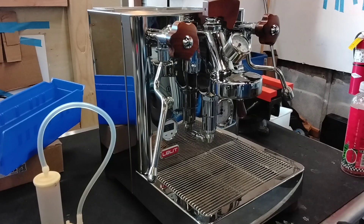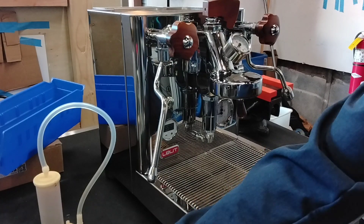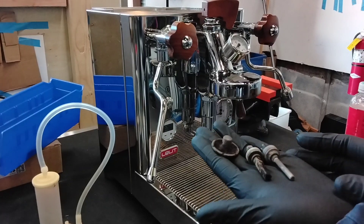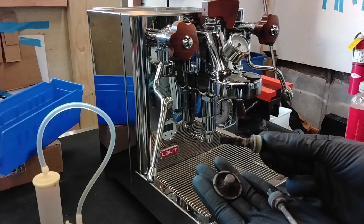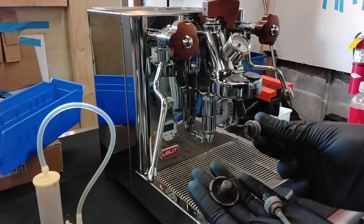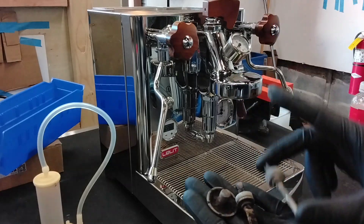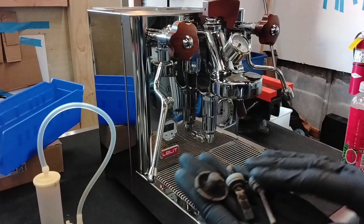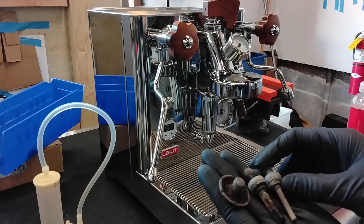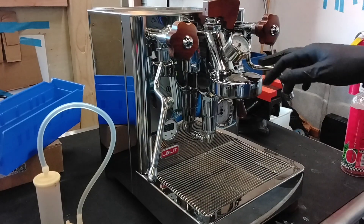Pretty much what we did to the machine is an overhaul because the machine wasn't kept too clean. I believe this is around three to four years old. We did an overhaul, which is replacing the valves on the machine. As you can see, here are the older valves — a lot of coffee buildup over the years. I'm unsure if it was ever backflushed or descaled at all. These things are just fully corroded. Coffee is a little bit acidic, so when you leave it on stuff like this, it just corrodes a little bit after sitting there on the valves.